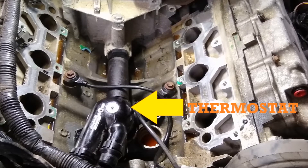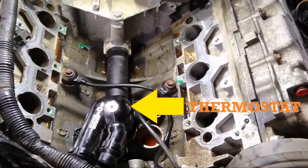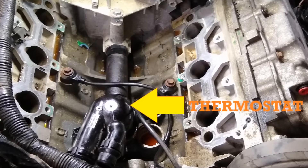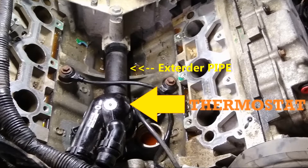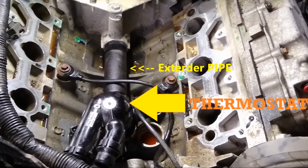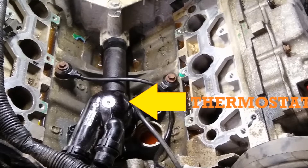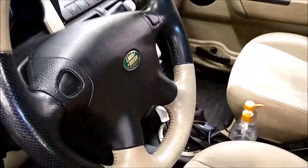The whole deal is plastic. In between the valley, there's a little pipe right at the end of the thermostat that's separate from the thermostat itself, and it's got two o-rings, one at each end. It's another source of trouble — oftentimes that piece leaks and it's a nightmare.